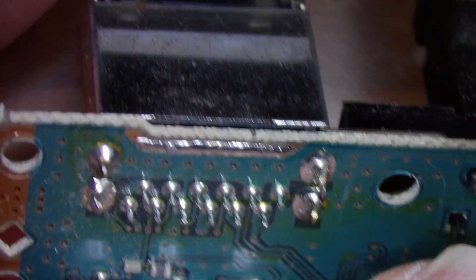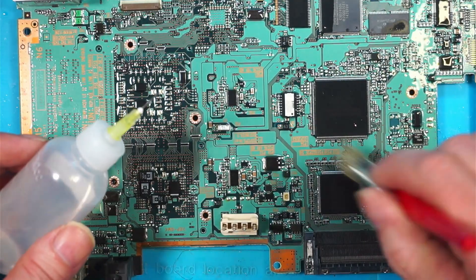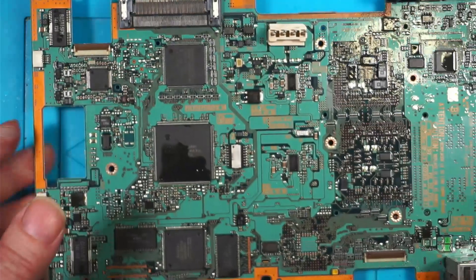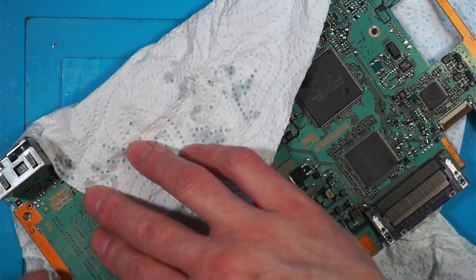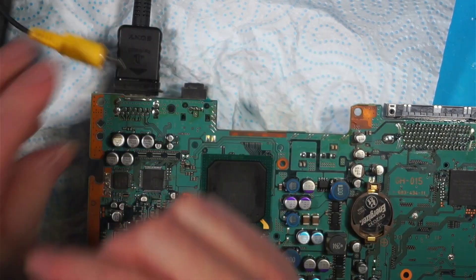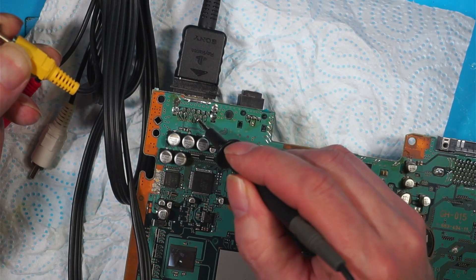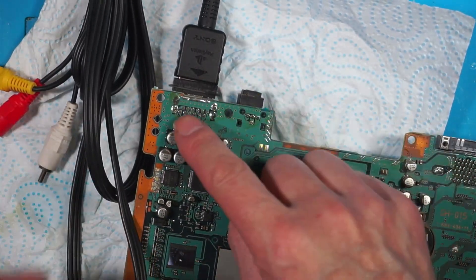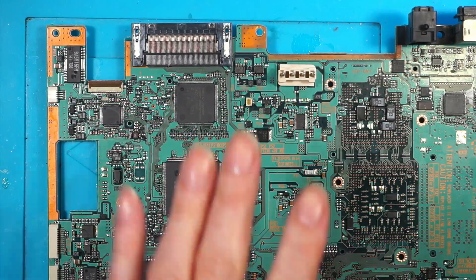I had expected the AV port to be the reason, so we'll clean that out. We'll give the board a good clean - that's the area I'm worried about. I think I'll put that back together and see if it's made any difference. I might have to focus on the audio-video port. I'm wondering which pin is video composite out - that one. I am getting a signal through the port, and I am getting a ground signal. So if I'm still not getting video out, there's a problem with the board rather than the port.